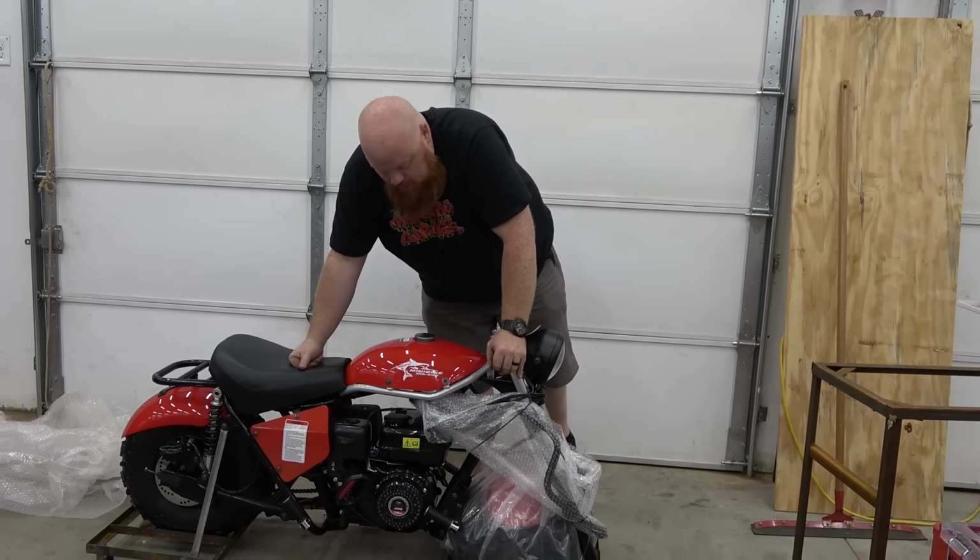So the last time we messed with one of these, Go Power Sports didn't have a ton of aftermarket parts for the chassis of this bike. So now they've come out with a modified triple clamp. You can see the bottom part's really beefy with this tube style, but the top part is like a stamped steel, and it's still pretty dang strong. We've never had a problem with them, but they do have like a quarter inch or something thick piece of steel that you can replace this whole triple clamp with, and we will be doing that.